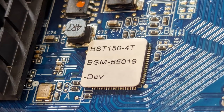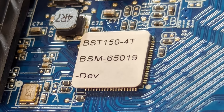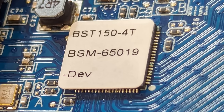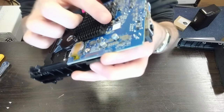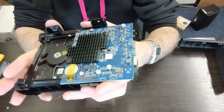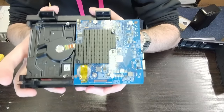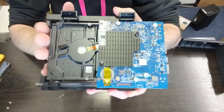Bringing things a bit closer, you can just make out the chip there — it's very hard to get the zoom to show it clearly, so I may put a splash image on screen. That chip holds the firmware, labeled BST150-4T, and will be linked in the description with images. One of the first things I'm really impressed by on this controller board is that there is no active cooling. It's a very power-efficient system, and similar to the DS124 with the same hardware architecture — purely relying on passive cooling.